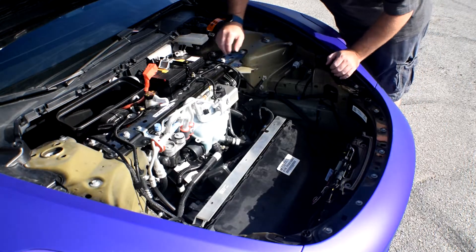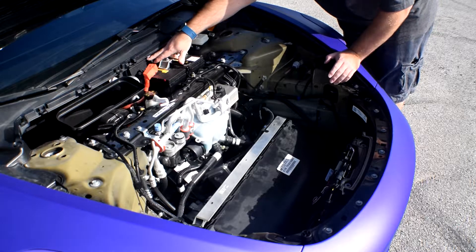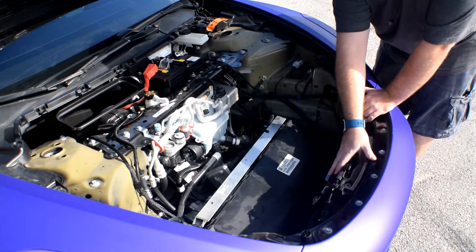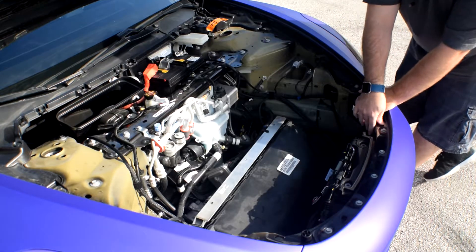Let's start up here at the very top. This is where we're getting power from — directly from the 12-volt battery, going through a fuse, of course. We come down and up here underneath where the front latch is; that's the power supply for the LED underbodies. Let's take you around and give you a better look.